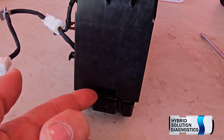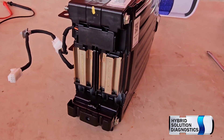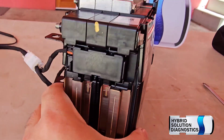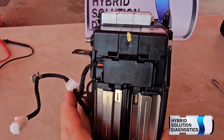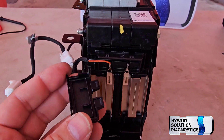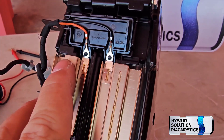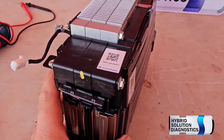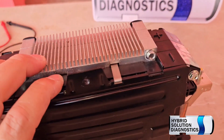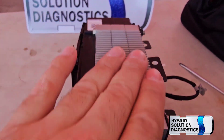Now in the back of the battery, just by prying this a little bit out, we can take out this cover. And finally we have two cables coming over here and I can clearly see the cells. Let me take out this cover. As you can see, we're very careful taking out this cover and we can see clearly these are voltage monitoring cables. Now let me continue taking it apart. I need to take away these clips over here. This is the heat exchanger over here. And finally, begin to open — one, two, three, four complete bolts that probably grab the complete battery as a whole structure.